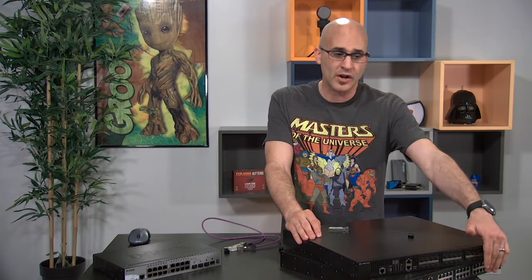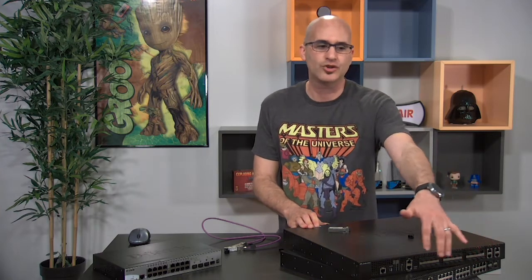The DGS series also has one other trick up its sleeve — a version that only comes with eight ports, and just like you can swap power supplies, you can swap port cartridges on the front of the unit. It comes with eight and you can add two more cartridges to give you a total of 24. So if eight is good enough now but you're not sure when you'll need to grow to 16 or 24, you can get a switch that allows you that overhead. Always buy more than you need — if you only have four people who need 10 gig, get one that supports eight. If you're at eight, get 16. You'll never regret having those extra ports.